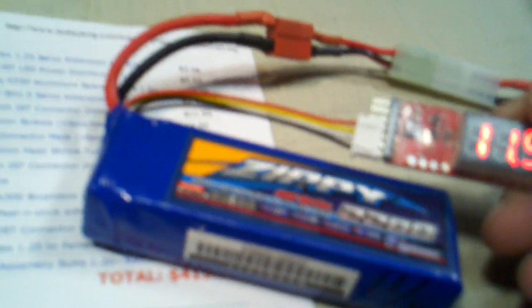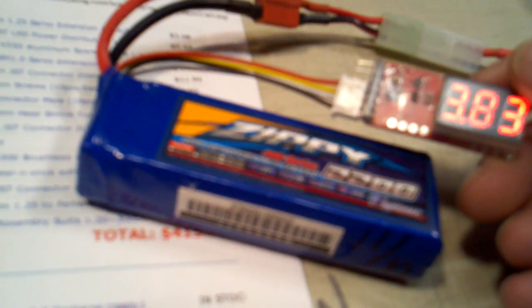We're only a couple minutes into this and the battery is now at 3.74 volts on the low cell. I'm going to go ahead and take it off the jump and plug it in now. You'll notice that your donor battery will not come down in voltage at all — it just needs to be a good battery. That one is still at 11.5 total volts.